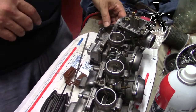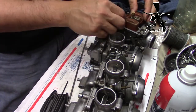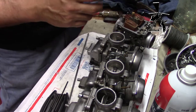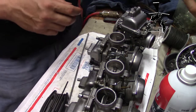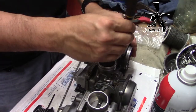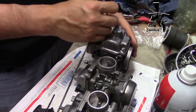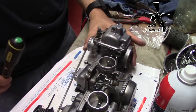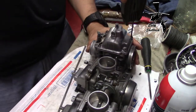Alright, I'm gonna put my float back in, put the pin back in, put this back on. I'm not gonna wrench these down too hard - I don't want to crush that gasket too much. But that's pretty much it - I'll give it a little snug.